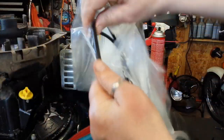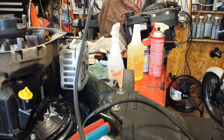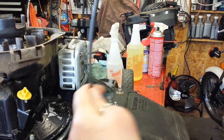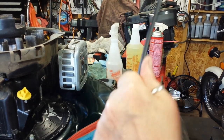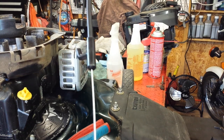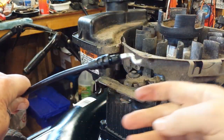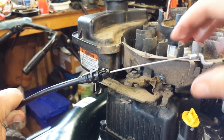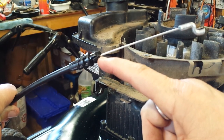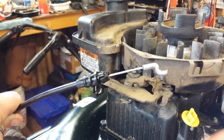Here's our new cable. We're going to have to tear into that, and oftentimes if it's been in the bag a long time you need to actually work on straightening the cable out a little bit to get that permanent bend out of there. You want it as straight as possible before you try to install it on the mower. Also, if you're in a less than ideal storage environment like outdoors under a tarp or in a leaky shed, you can put a couple of drops of motor oil in there and work the cable in and out. Don't use grease — that can freeze up in the winter, which would be difficult to undo.